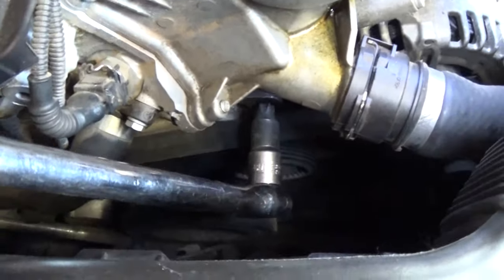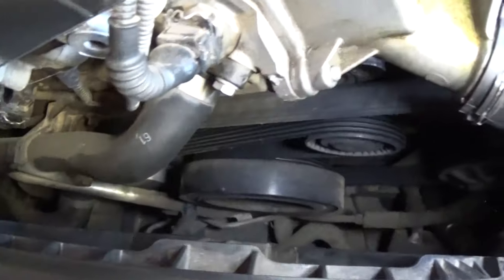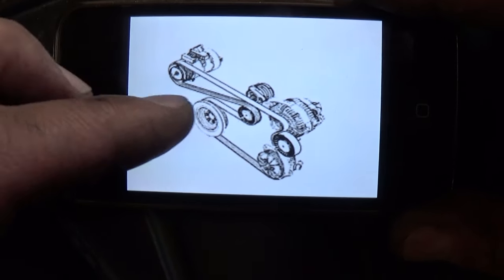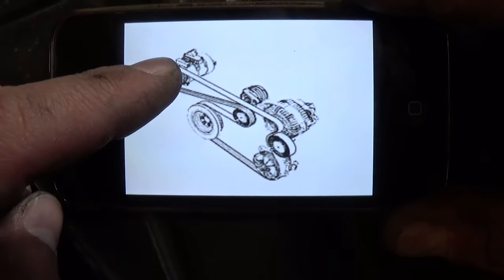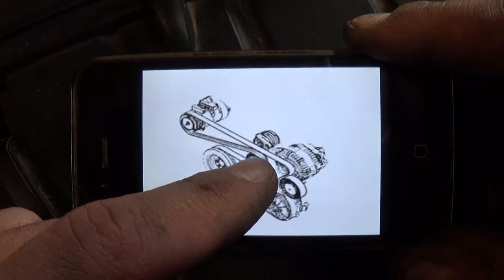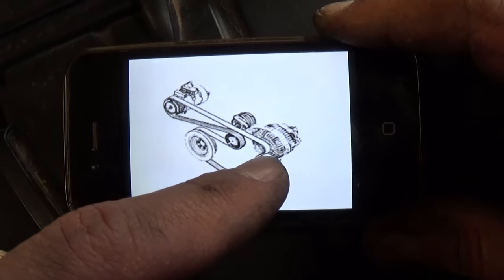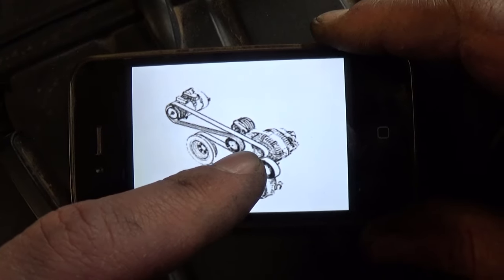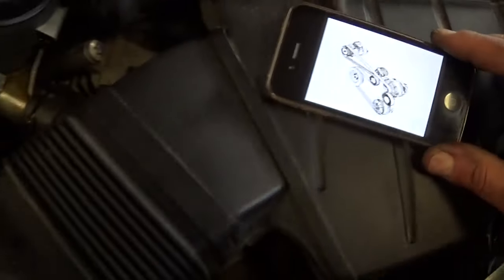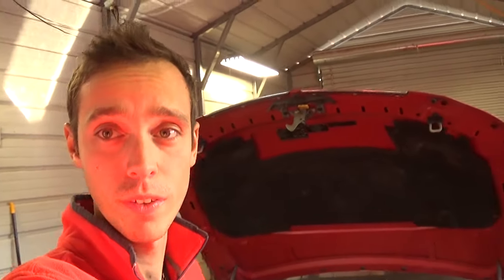Be careful — if something is wrong it's going to come off and you can burn it. So this is the diagram: that's the AC compressor. Looking at the engine from the front — crankshaft pulley, tensioner pulley, then power steering, then around that little idler pulley, then back to the alternator, and all the way to the AC compressor. That's the whole procedure, guys. Thank you for watching — let us know if the video was helpful and see you next time.